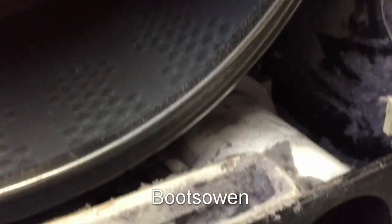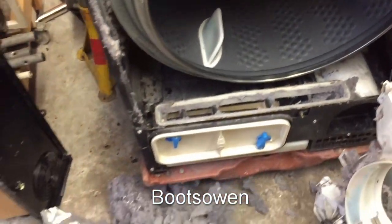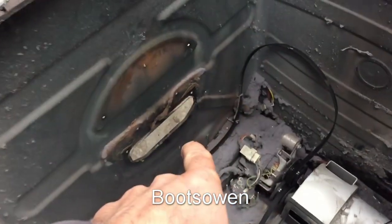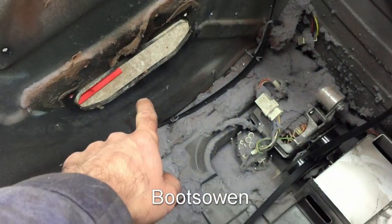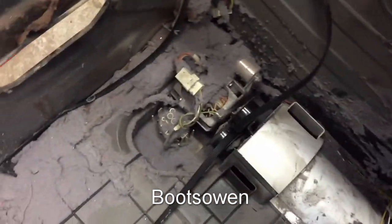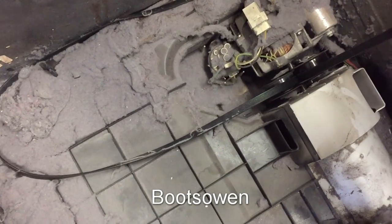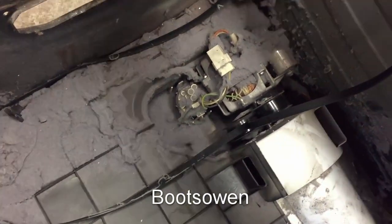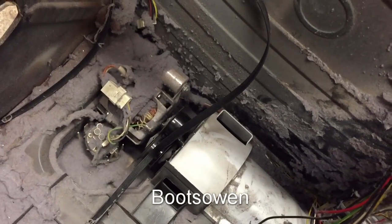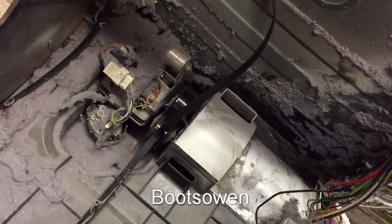There's a lot of fluff there. Still quite a bit around the machine. I've removed the drum. Basically to do that, you take the back cover off and then there's a screw on top and a screw on the bottom and it just comes off. How you line it up again is a different issue. And how I get this belt off here is another issue as well. What I could do is just drop this belt and leave it down there and not worry about it for the purposes of this video.